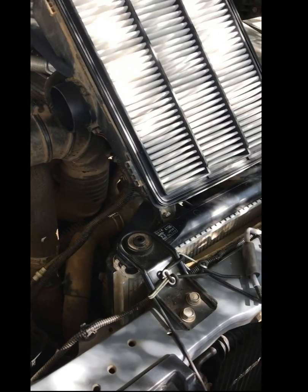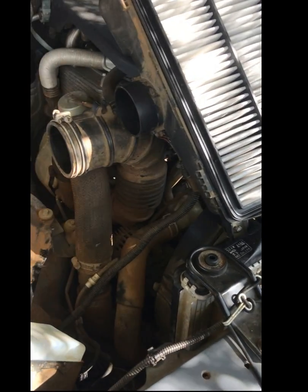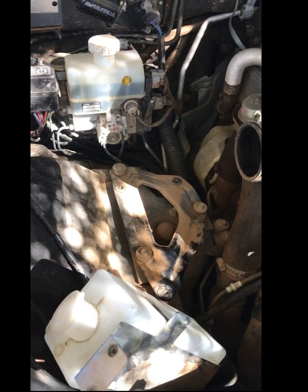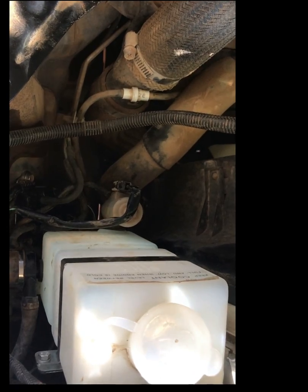Now I've got to do everything in reverse — put the water bottle back, put back all the air filter components, and give it a test run. Hopefully this will also stop an annoying little rattle, a sort of grinding, grunting noise that I've been hearing, which has been really annoying me for quite a while. I've put the aftermarket snorkel water bottle back in, and I'm glad I removed it — there's no room to move in there.